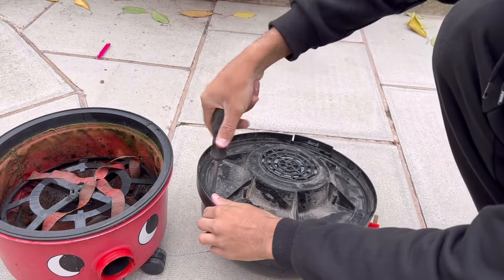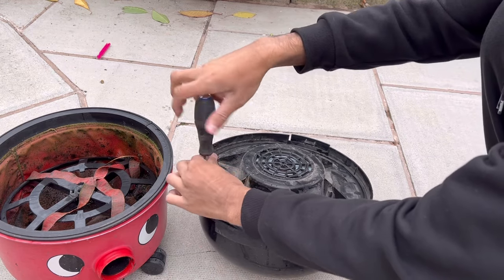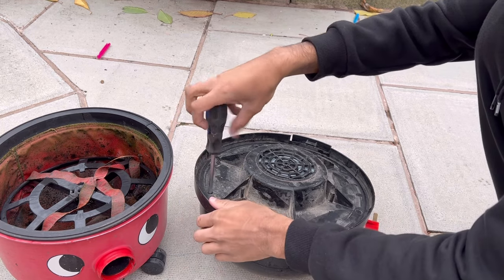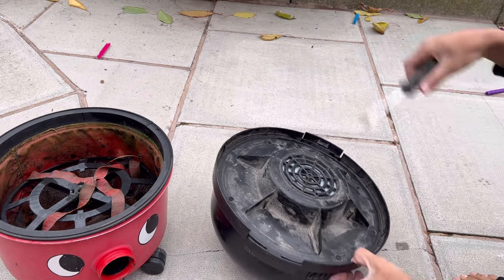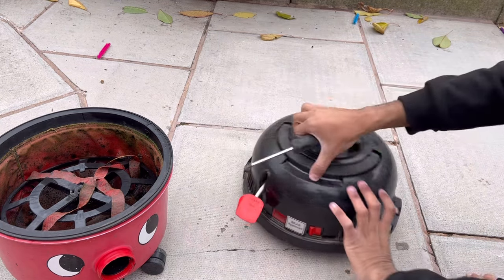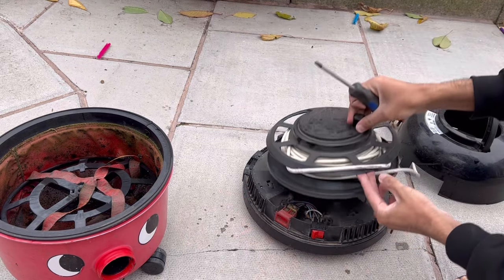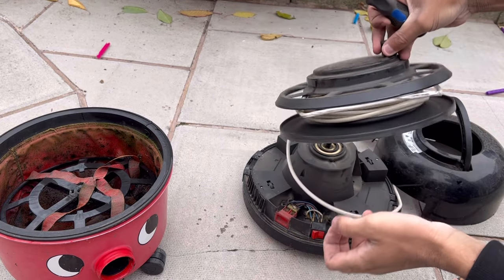Now I've got a nice 1993 model. What I'm going to do is get the cable rewind from the cream and brown Henry and swap it over to this one to see if it works. I've got four screws on the base — flip it over, lift up the lid, and wow, no wonder the cable rewind was stiff. It hasn't even been fitted correctly.